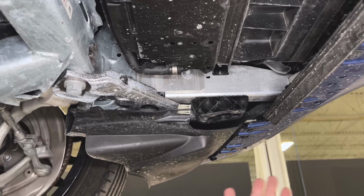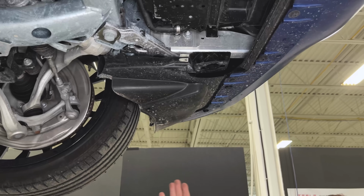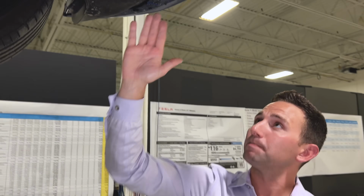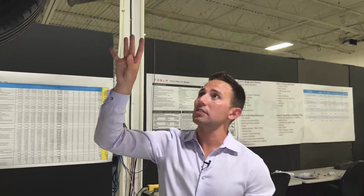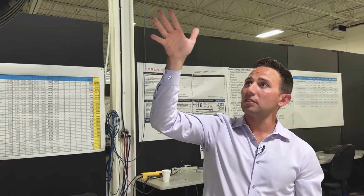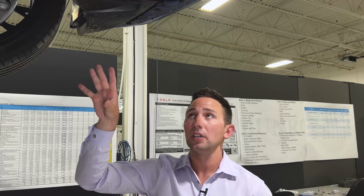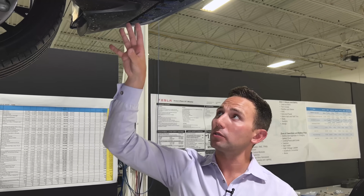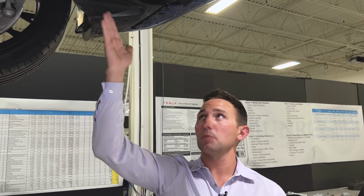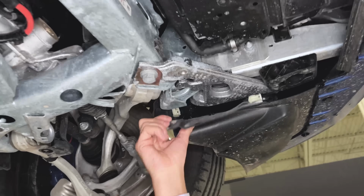It's where a rigid barrier is going to engage from a crashworthiness perspective within 25% of the overall vehicle width. And so what this casting is doing specifically is, upon the initiation of the barrier to the front of the vehicle, it's going to start taking up some load. That load is going to be transferred through that casting, and it's going to be essentially like a battering ram into the front lower control arm attachment.